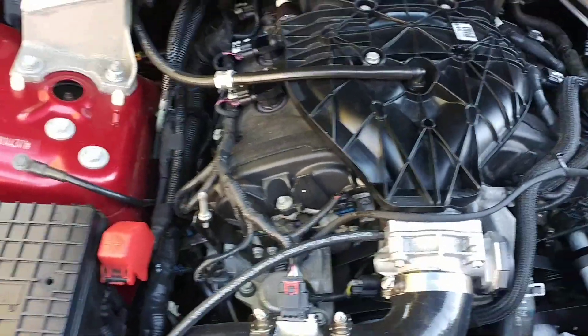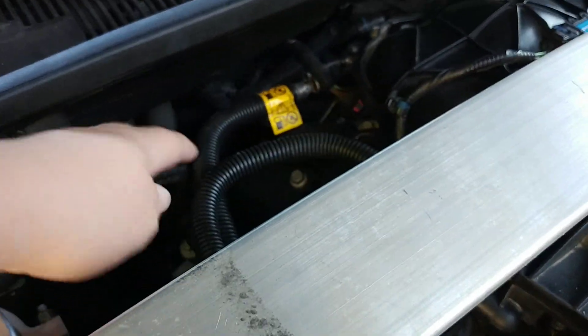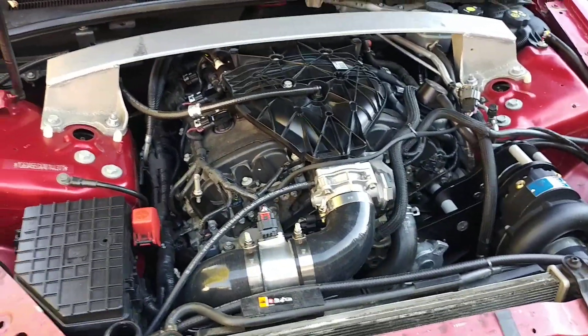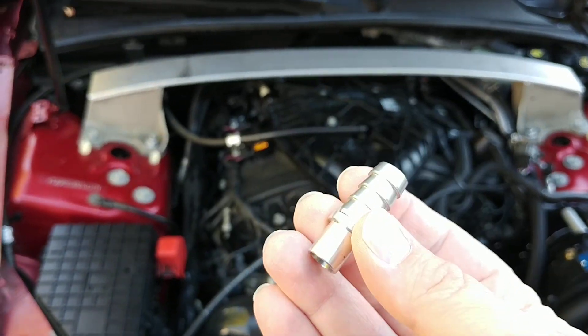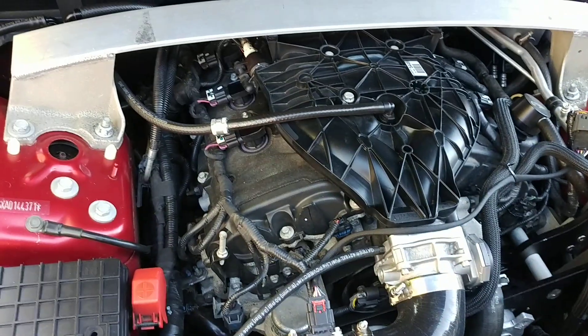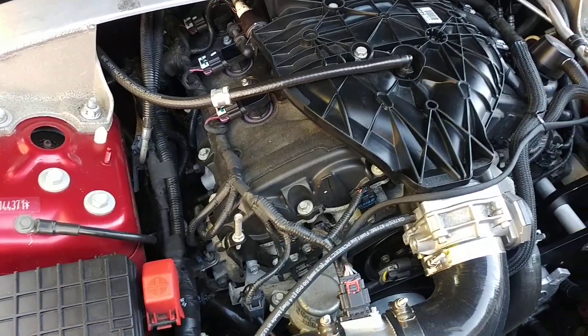The reason that we sell a plastic valve cover for the Overkill superchargers is for the PCV valve. Right back here is the outlet for the PCV system, or the dirty side. It connects to the back of the valve cover and then runs to the inlet on the catch can system. We replace this with a larger barb because the factory PCV valve is very, very small. This barb can only be replaced on the black plastic valve covers because on the aluminum valve covers the barb is molded into the casting — so we can't change it out and you'd get poor flow from your PCV system.